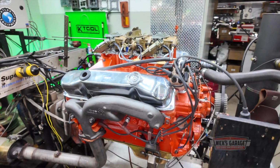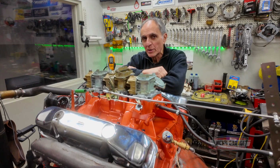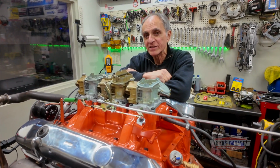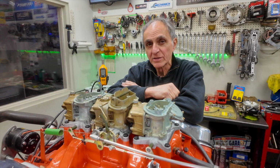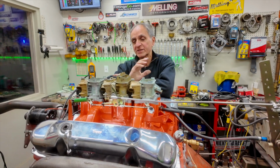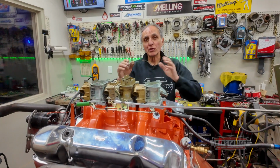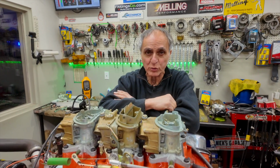You know, I did change one thing. A lot of these engines I'm building with a 20 thou shim gasket. But I've noticed that some people, when they cannot get 94 octane and they find 91 octane, with the 20 thou shim gasket, it will not work. It's going to ping a bit. So on this one, I'm going to go with a little bit thicker head gasket. I went with a 39 thou instead of the 20 thou.